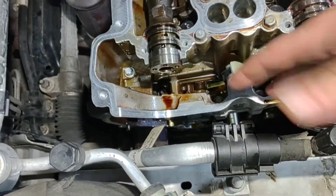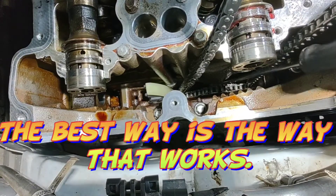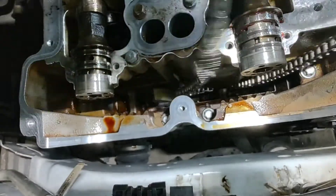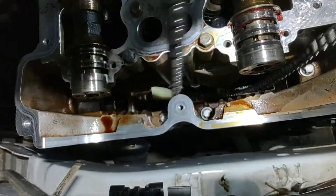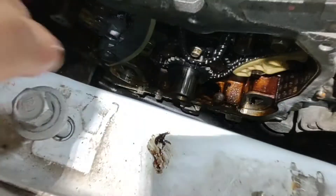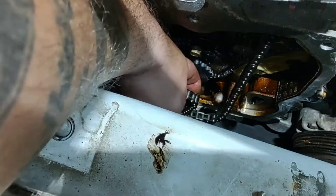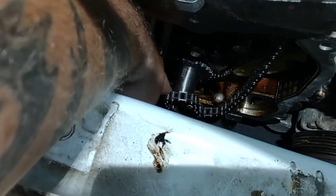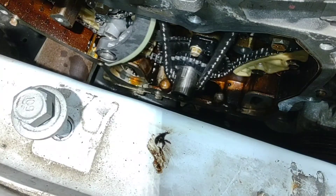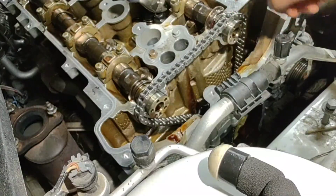Get the guide on the left side and drop it down in there. Alright, time for the timing chain — make sure it's facing the outside so you can time it right. Drop it down in there — there's bumps on the top right and left. On the bottom side push that in first to get it over. Drop it down, get it over your oiler — there's going to be quite a bit of slack. You can spin the crank as much as you want to find your cam links.